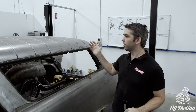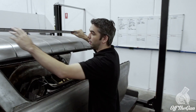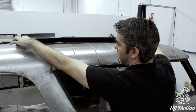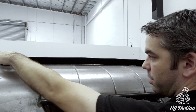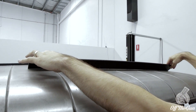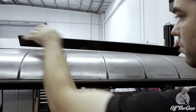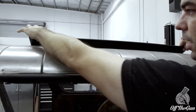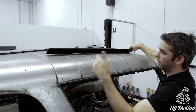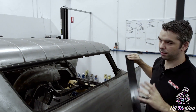Probably the roof on these things is relatively standard, but easily with the spline, once we throw it over the top running across the surface, we can see where those pressings are, how much change there is, how much variation there is to get a continuous surface to run through. You can see right in the center there are two or three sections that are significantly lower than the others. So we've got time to get those bumped up, or we know if we're going to put those into filler, how much filler that's going to need to get the right shape.